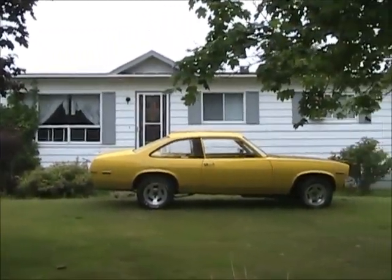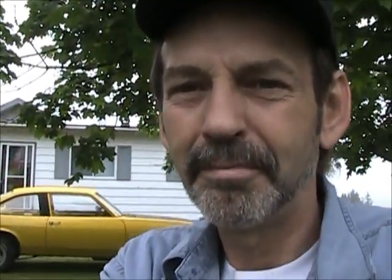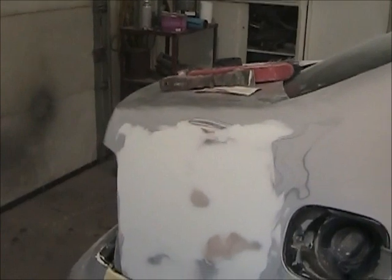I'm just glad when I can get to drive it - that'll be a year. Just a quick video showing how I put those springs in. I don't recommend anybody do that at home. Got that blister taken care of, another one starting there in this area - took care of that. Where the mud flaps was digging in, treated that and took care of that. The rocker - gotta sand the whole side with 400, then prime the spots.